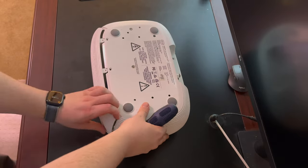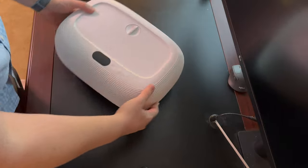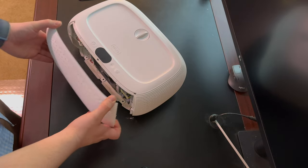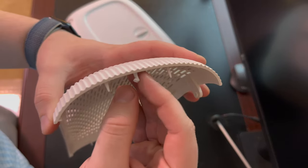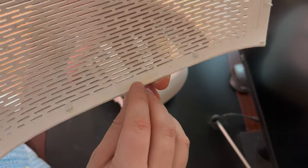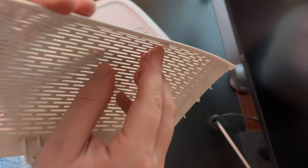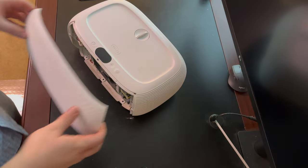There's one side, there's the other — I'll show you what these clips look like in more detail. To get this out, the best thing you can do is kind of push up and out on the diagonal. Over here you can see a retention clip, and the same thing on this side. Then the top has these little pegs on the center and each end to keep things lined up vertically, and you have these pieces sticking out below that line up as well — that's why you have to do that diagonal pulling-out motion.